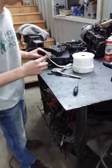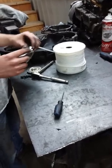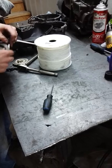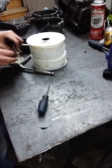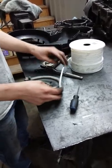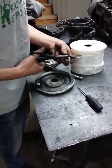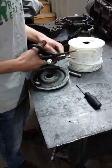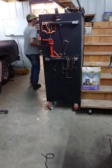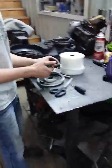You see I'm actually going more than what was on there originally. I can fit a bit more and that's about where I want to be. I just got to go around to this final notch here and add a little bit extra in there. Then I can cut that off there. Always whenever you cut recoil rope, you always have to take a lighter and melt the ends after.